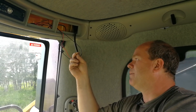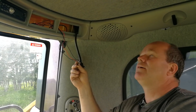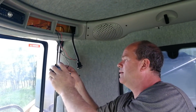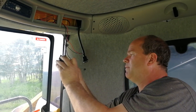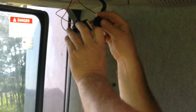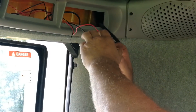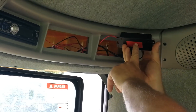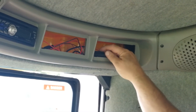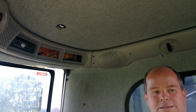You need to sort out your antenna mounting strategy if you're not going to mount the data logger on the center line of the cab. In our case, we have placed it up in the headliner forward to the light. Simply thread the antenna connector onto the SMA connector on the back of the data logger, plug the DB15 connector into the back, and tighten the two screws. There's some double-sided tape mounted on the bottom of the box for securing it in a fixed location.